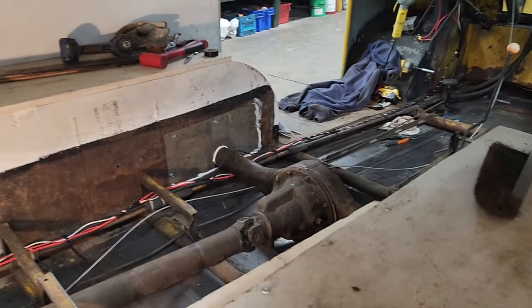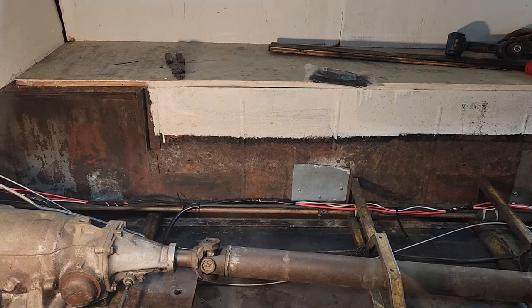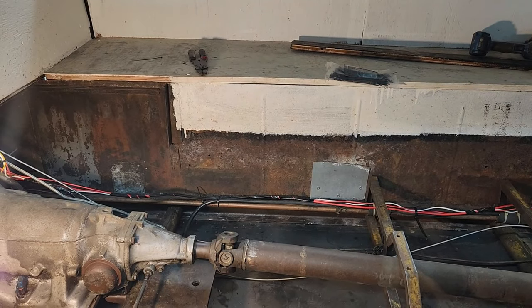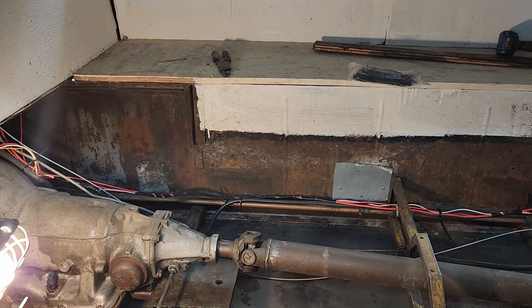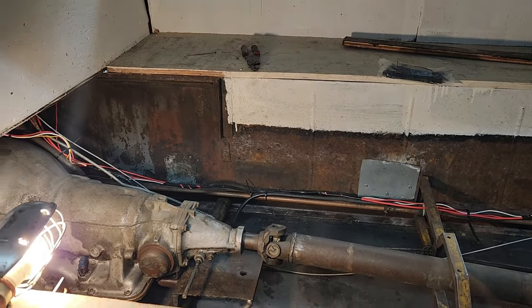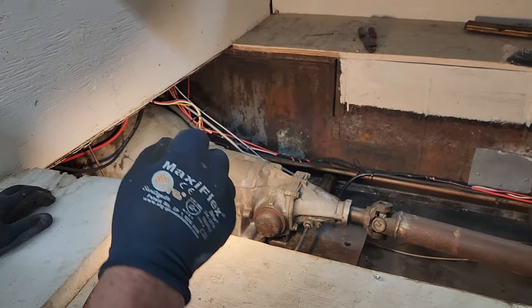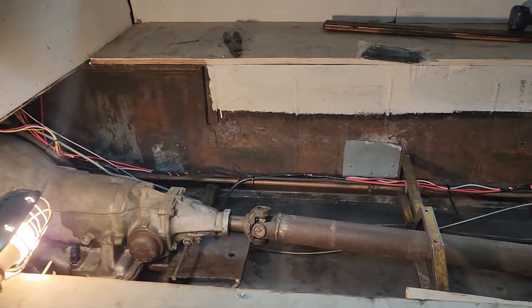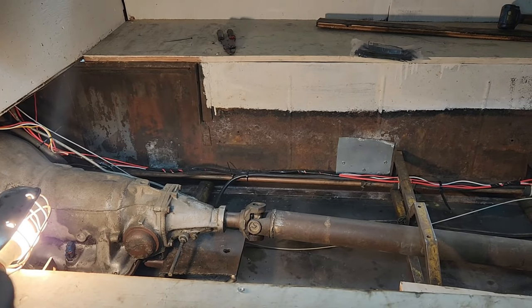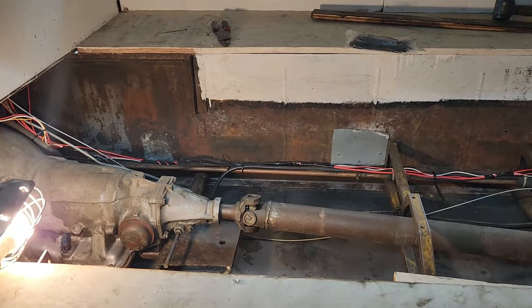Okay, so that's what we're going to do here next. So, do I need to clean up there with a wire brush first? No, nothing. Okay. I'm going to drill the holes. And then I'm going to put a rivet in, and I have a rivet washer that goes over the outside of the rivet. I'll pop them on there and we're done. The washer on the outside of the rivet holds the rivet really tight to the metal. Then it can't bend either.